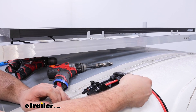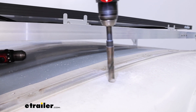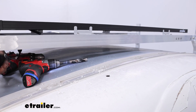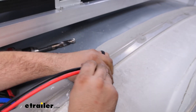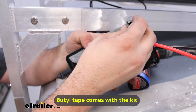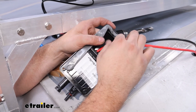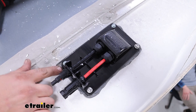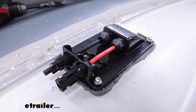I also found a rubber grommet that's going to help seal up the hole. Butyl sealant is pretty common when you mount anything on the outside of a camper - it makes sure that long term, once you drill this down, it creates a nice seal and we're not going to have water going into our camper. With this mounted up, we have our butyl pushing out - I went pretty excessive on it but that's not a bad thing because it's going to create that nice watertight seal. Now we can head inside and continue on with the installation.